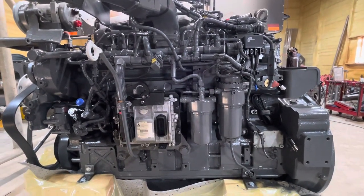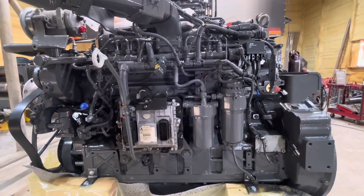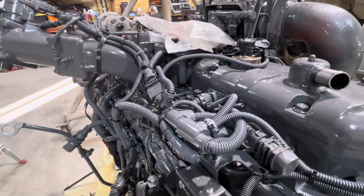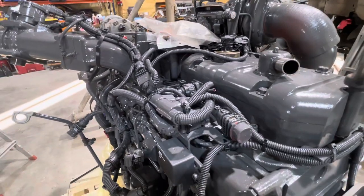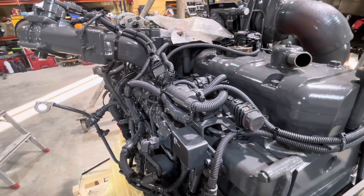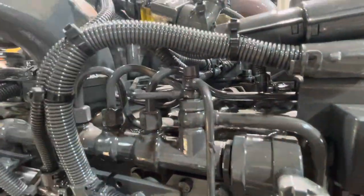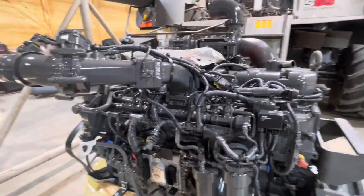Just some little tidbits to save yourself some time in the field. I'll probably spend a couple hours just messing around here — unclipping and rerouting the wiring harness, trying to get things to lay better. There's really no great way, but I just kept playing with it until the wires weren't too kinked. The biggest thing is just getting that stuff routed above those fuel lines so it's not rubbing against them.